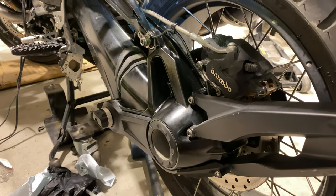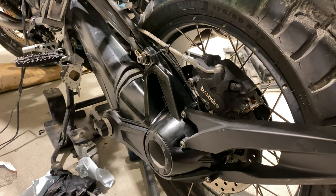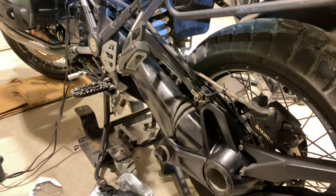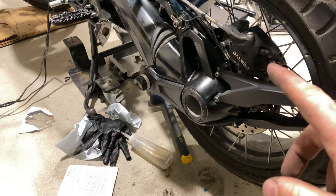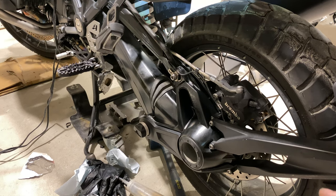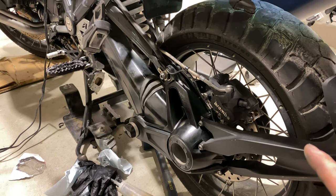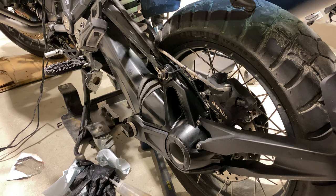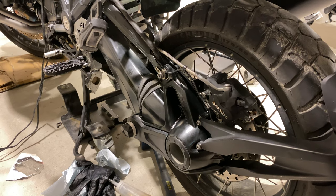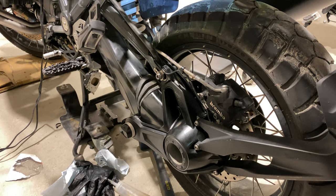I'm not a mechanic but I think this went really well, and hopefully it helps someone. This is a normal 12,000-mile service: pull the possum scraper, pull the final drive guard, drain the final drive fluid, pull the brake caliper, pull your final drive breather, drop the final drive and lube it, lift it back up, replace the brake pads, and fill with 170 milliliters of fluid. I'll link the torque specs for all this work in the description. Rock on and be safe — thanks for watching!